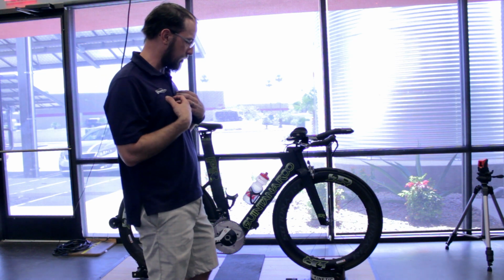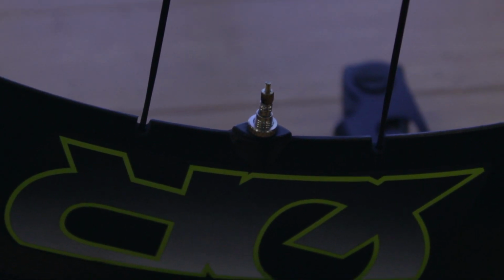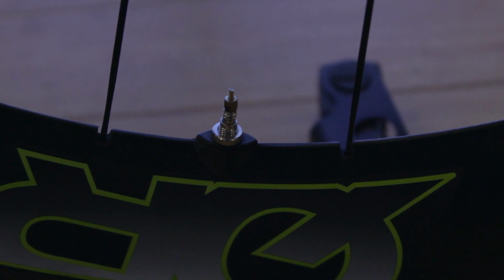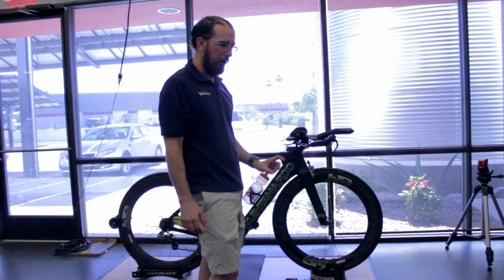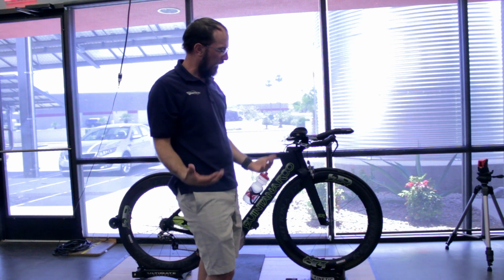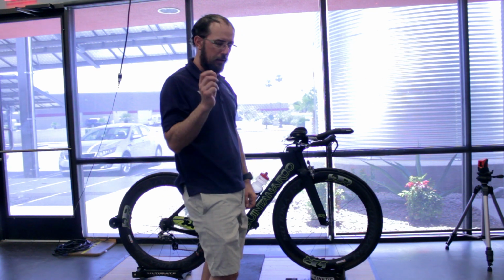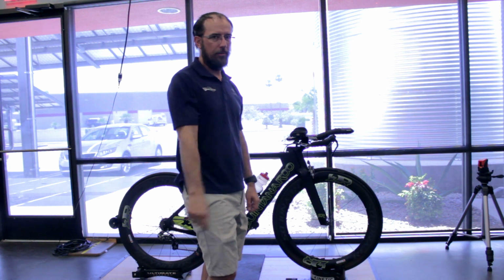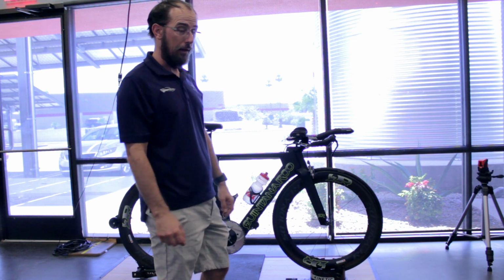Of note with me specifically on these wheels, you have to make sure that your pump fits how much stem you have coming out of here, which is true with any wheel, but this wheel in particular, the way it comes spec, there's not a lot of valve sticking out, and I had some issues pumping up my tires of all things. But I got around it. A Presta valve adapter was the secret sauce to that solution. A $2 part made my life a lot easier.